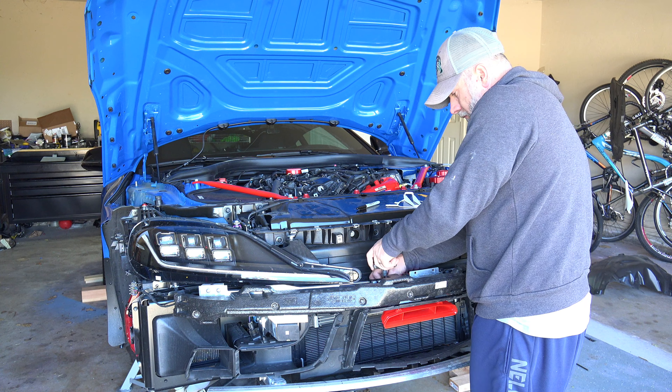Now that I've got this piece in here, I've got to put this inner one in — we'll pull it apart, this one goes inside and lines up just like that, lining up with the hole underneath the bracket for the headlight. It will sit just like that, so the cold air will come in here, up through this elbow, and get routed directly into the air intake — which is exactly what we're looking for. Let's get this thing installed.